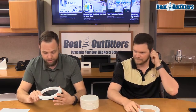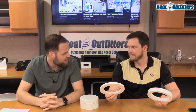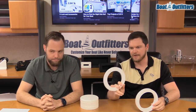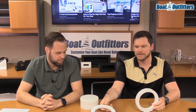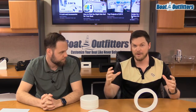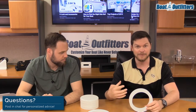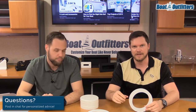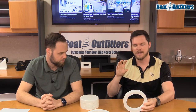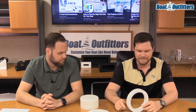Matt, you want to kind of show me what we've got right here, and chat about the different applications you might need to use that for? Absolutely. The speaker trim rings are kind of self-explanatory, but the main reasons you run into needing them are, one, you're getting a different size speaker, maybe going smaller, and you need to cover the area from the old cutout, or two, your new speaker is deeper than the last speaker you had. It mounts deeper, and you need to get some space off the mounting surface so that when you put the speaker in, it'll mount up flush, nice, clean, and get good sound.